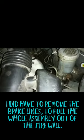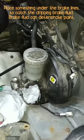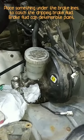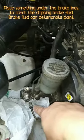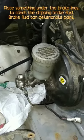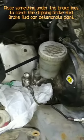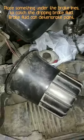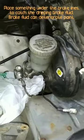I'm doing this without removing the master cylinder, seeing if I can get it to work. Remove the cap — I took a syringe and drained all the fluid out of it. The lines are 10 millimeters, so clean them off really well so there's no chance of slipping with the wrench and rounding off the nuts. Then 10 millimeter removed them, and I also had to remove my old alarm siren so the brake booster would clear, but it should pull right out.